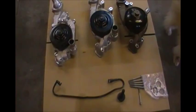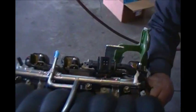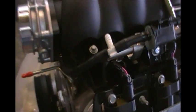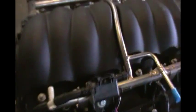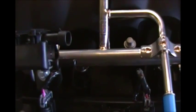Let's take a quick look at the purge valve, which Ronnie is plumbing. He took the purge hose off — this is the source, or the vacuum line, to the purge valve. We've relocated the purge valve to the driver's side fuel rail, and Ronnie has now plumbed it directly to the throttle body for vacuum. The purge side is actually going to connect to this fitting here and go back to the vapor canister. This white vacuum tee is going to be used for an auxiliary circuit, which I'll show you guys later.